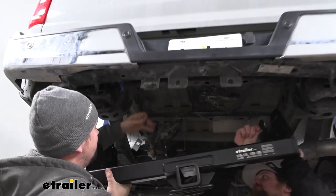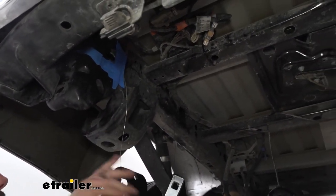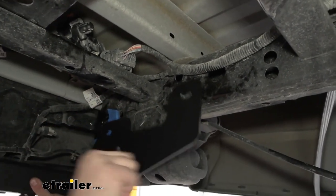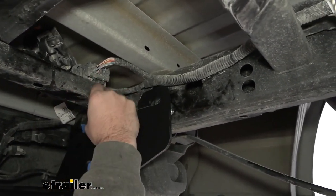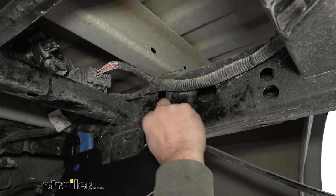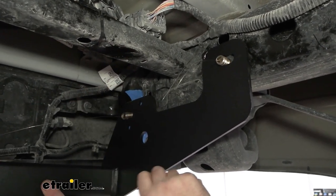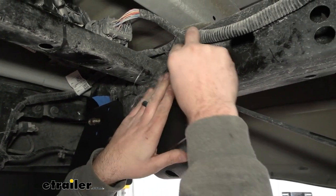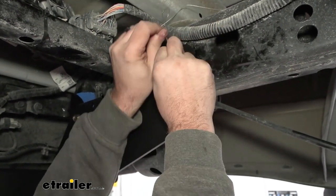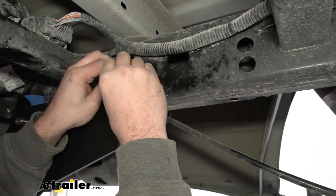You're going to want an extra set of hands to raise the hitch up in place. Make sure those bolts are passed into the frame for now, and then feed your fish wires through the corresponding holes and slide this up, pulling out the slack as necessary on the fish wires until we get this all lined up. Try to get one of these pulled through on each side just to support the hitch. Align this up, and once you get one started there, you can get the other one in place — that's going to hold our hitch up. Once you have that held in place, you can use the hitch for some downward pressure, remove your fish wire, and with your serrated flange nut, get it hand started — one on each side — so we can get the rest of the hardware up nice and easy.